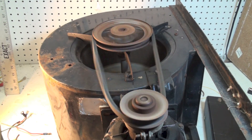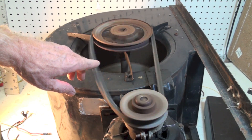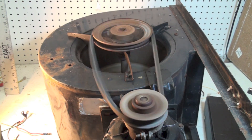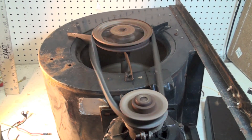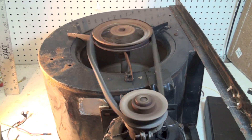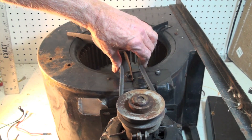We're going to fire this off with a really loose belt. It didn't squeal or anything on startup — it just started up. But you can see that belt's flopping all over the place to one side. The other side is tight because that's where it's pulling the power. I think maybe this is a little bit too loose; it probably wouldn't come off, but I'd rather have it a little tighter than that.